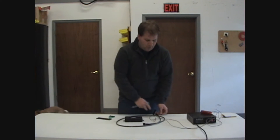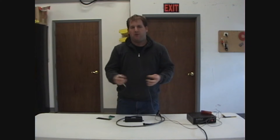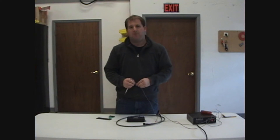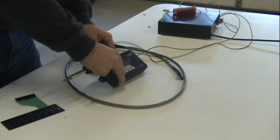Then you bring a ground wire, and this is also included with the kit. It's an 18 gauge wire. You'll bring that in from a ground location in your firewall or in your rocker panels, wherever you can get a ground, and you plug that into the ground location.